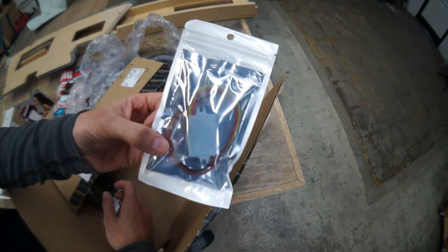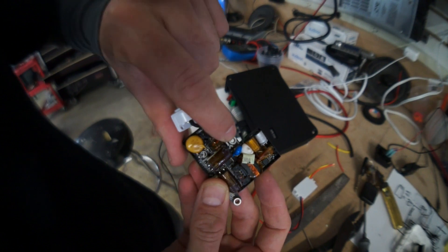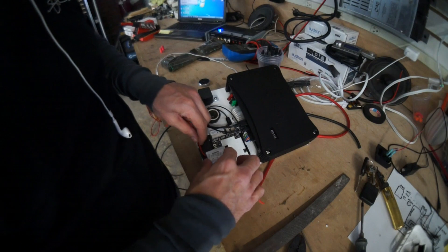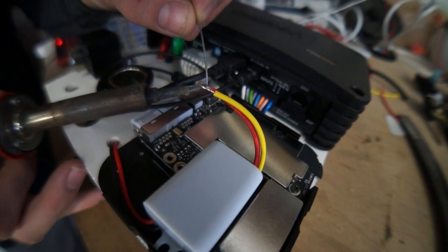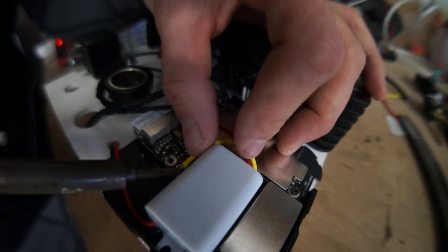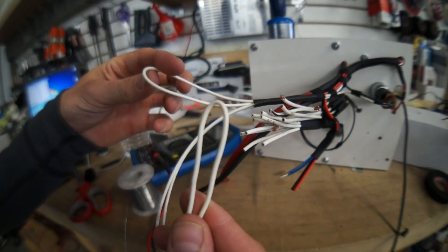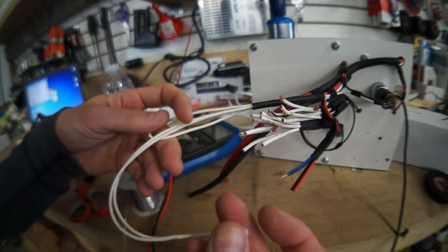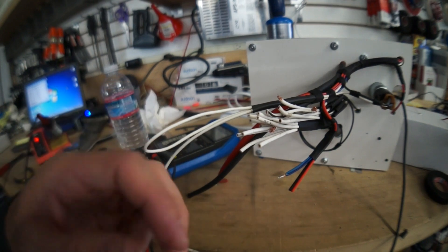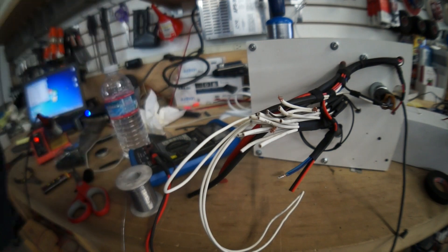I got this off Amazon — this is a 12-volt to 3.3-volt converter for the Apple Airport Express. That says ground. We're just going to swap out the existing power supply and put this in there. These two loops are ready for switches to be hooked up to them so I can bench test this for now. Later on when we wire up the switches in the car, I can cut this loop and hook up a switch to turn off the charger, and another switch to turn off the Apple Airport Express.